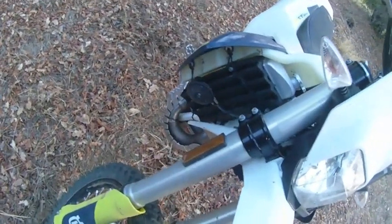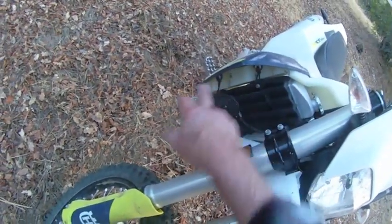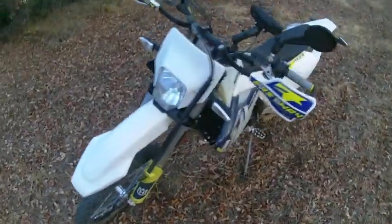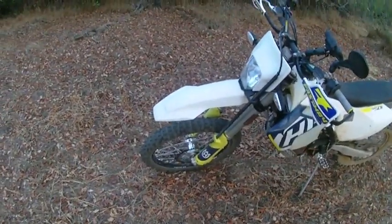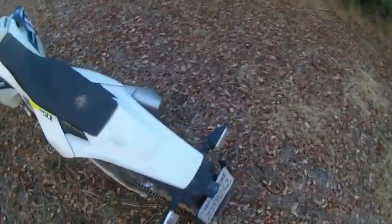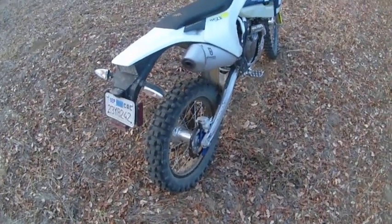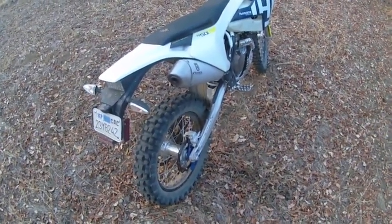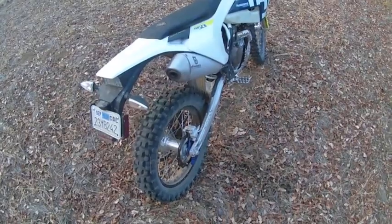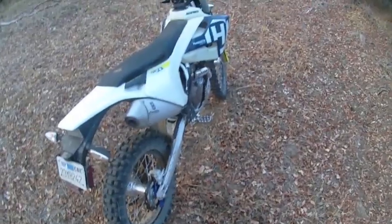And somebody gave me a good hint when the thing was empty. I put in 1 gallon at a time and just drew lines on there so I can always look at the tank and go, okay, I know how much I've got in there. So now the tubeless tires are on, running 12 pounds in the front, 4 pounds in the rear. And you can only do that 4 pound gig with the Maxxis tires because the carcass is just so hard. But that tire's got probably a couple hundred of miles of asphalt on it. And then a whole weekend ride to Tahoe over the mountains and then bopping around here. I did a 90-mile loop the other day.